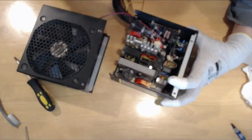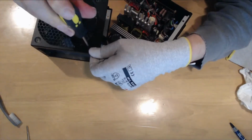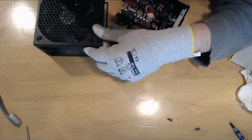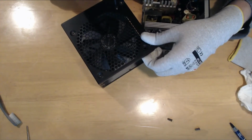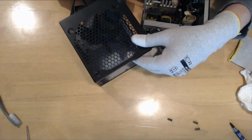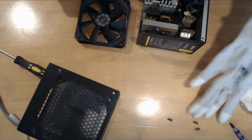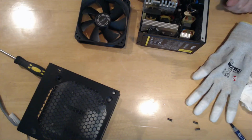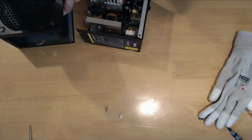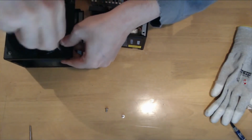It doesn't make big difference to the next stage, that is to blow out all the dust residing inside the PSU's chassis and remove any dust that might lay upon the blades of the fan with the use of a brush or something similar. After you've done this, it's time to put everything back together. Mind to place the fan as it was, in our case with the side that takes the air inside looking at the top.